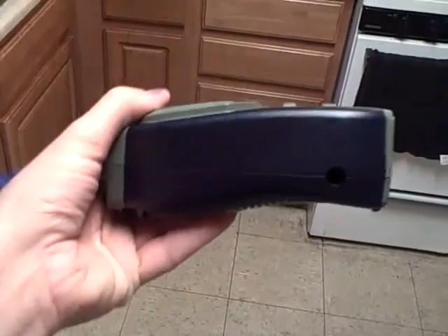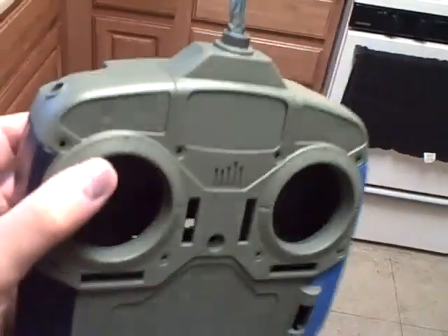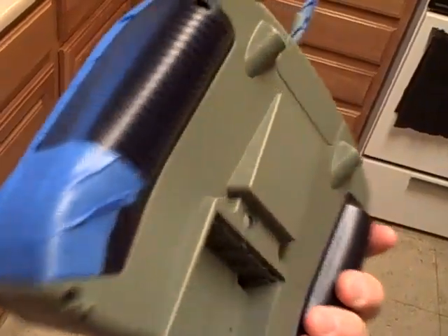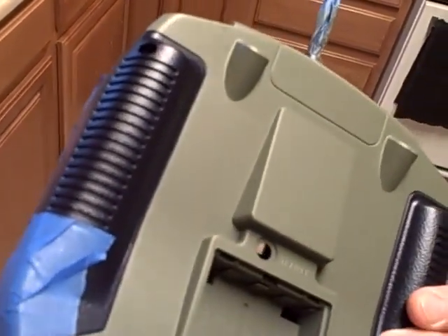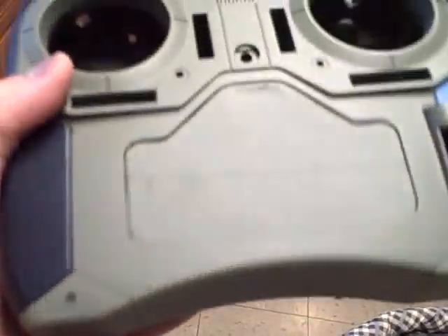Right now I've got the handle grips on the side of the DX6 painted the True Blue. You can see it. Instead of black, I got this self-etching primer on right now. I'm in the process of masking up the side so that I don't paint the orange over top of that. In order to get that nice bright orange, instead of what Tony did — he took his clear window out — I taped over all my emblems and stickers on the top, because I just didn't want to hassle with maybe ruining them trying to peel them off.